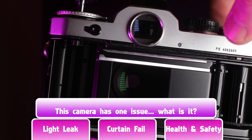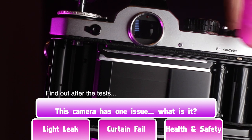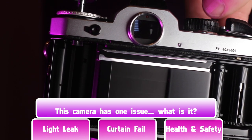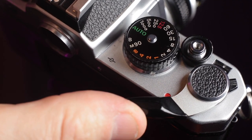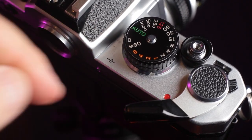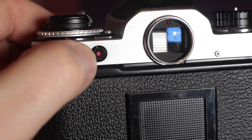The first thing I want to try is: does it cock? Does it fire? When I press the shutter, does it click? Make sure it's not sticking or stuck in any way. When I got this camera out of the box, the advance lever wouldn't go forward at all — it was just stuck. Straight away I thought, it's got internal electrics — what are the batteries like? I replaced the batteries and it came back to life. The little battery tester on the back — the little red light comes on — so I know the batteries are good.